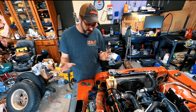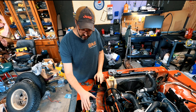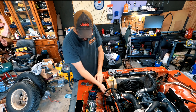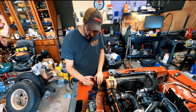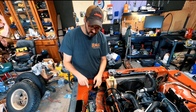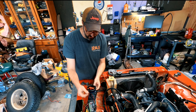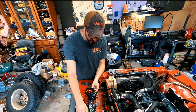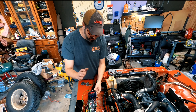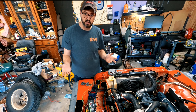Okay, I've got everything very much jerry-rigged at the moment. I've got the Dakota Digital box hooked up, I've got the alternator hooked to the input on the box, and I've got the tachometer hooked to the output. I know I've got it wired right because I can do a test signal and see it move. This other wire is just a dimming wire for nighttime dim — didn't need that. Now we are going to start it up and see if this actually works.